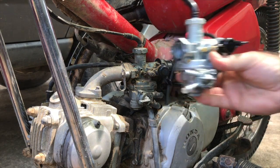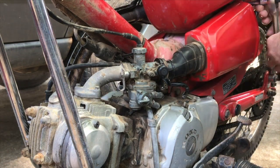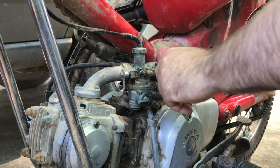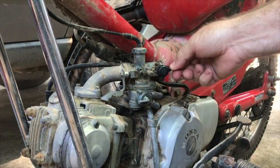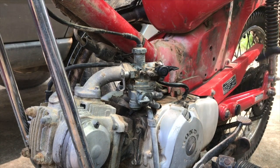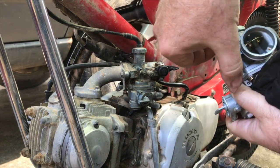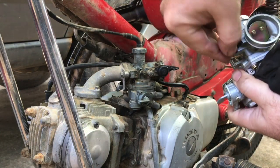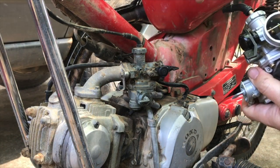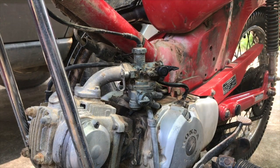The rest is just front and back, and then I'll need to work out the throttle linkage. Well, that was one problem there — the choke doesn't work. It stays open. On the new one, you can see the choke should open and close like that. Down is normal running; if you want the choke on it has to be up — it chokes the air, it holds the air back. But this one is just jammed open. So that's one problem. I can also see a whole lot of dirt and stuff inside it, so I think I chose the right answer to replace the whole thing.